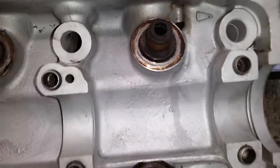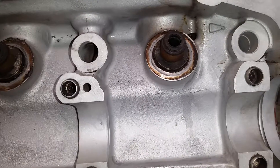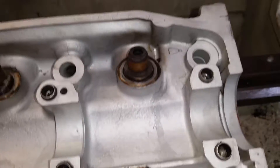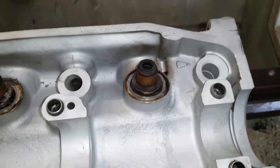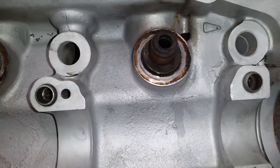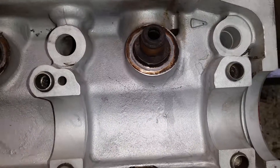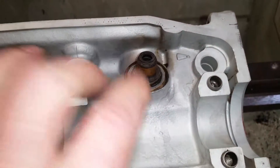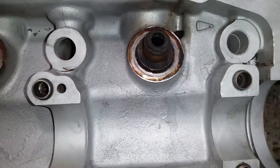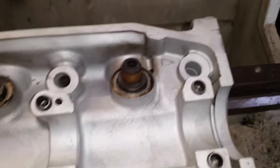So look, that was a quick and easy way. Give it a clean, wipe it down dry so that anything that's left is in a crack, and anywhere you suspect, just apply a little bit of heat. It's not enough to cause damage — I can touch that now — so it won't harm a good head. But if there is somewhere where you suspect there's a crack, it'll show up, because all the oil and fluid in the crack will start bubbling out. I hope this helps and saves you guys some money.